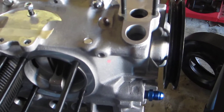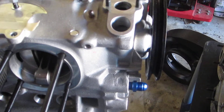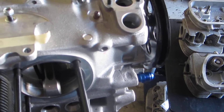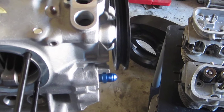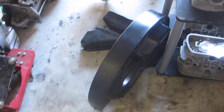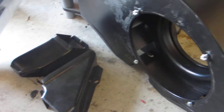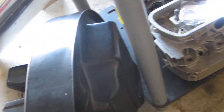This case has been full-flowed — you can see a fitting sticking out there, the return fitting. I don't have the oil pump in yet; I'm going to be doing some blueprinting of the oil pump to make sure all the clearances are good. Coming down here into view is the doghouse shroud I'm planning on using and some of the rear tins, or front tins if you prefer. You can see in the back of that there's the offset oil cooler.